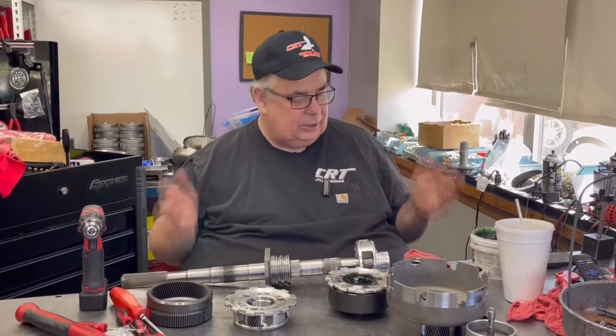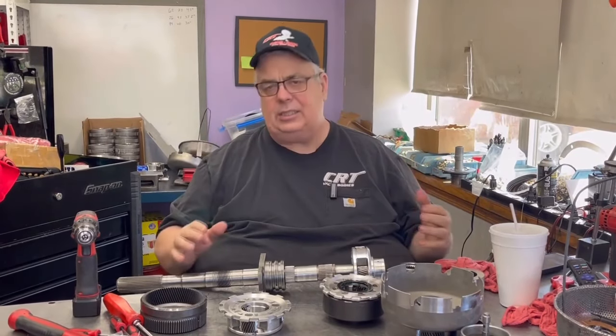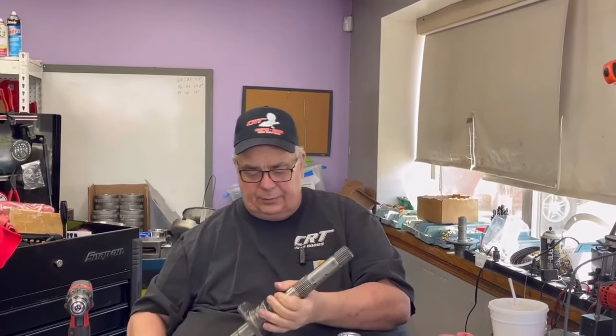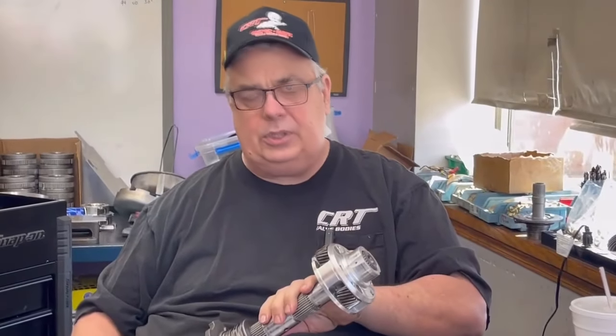This is going to be an official Two Hex Garage technical tip because I have Jeffro's mic on. Okay, so we're going to talk a little planetary here. This is a C6, but this will apply to any transmission. We have here the output shaft. As you know, the output shaft is a slip yoke. It goes to the drive shaft, which goes straight to the differential. The front planetary is splined right to that output shaft, okay? So under transbrake application, this aluminum planetary on a steel output shaft is going to take the brunt of the hit. These planetaries, splines on the inside, they will strip out. Now, I don't know about the Fords, but in Mopar 727s and 904s, they definitely strip out.